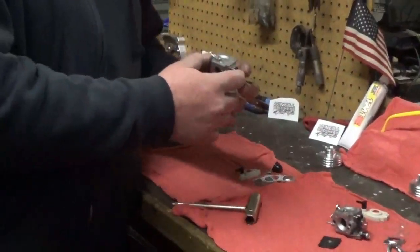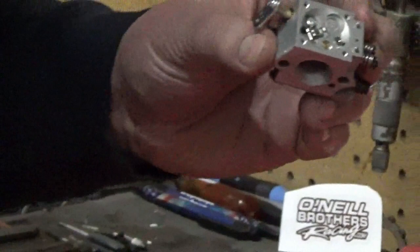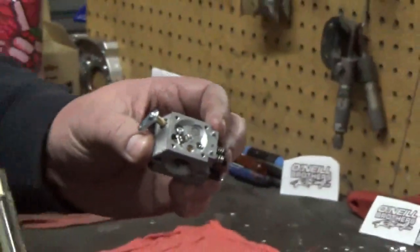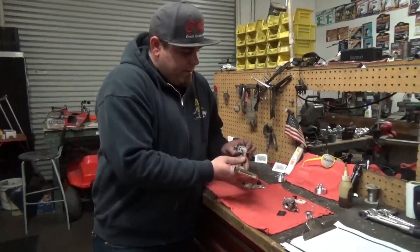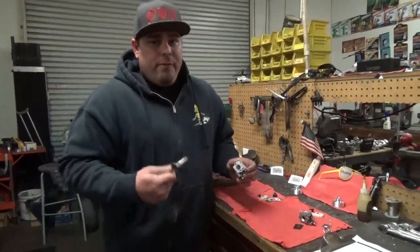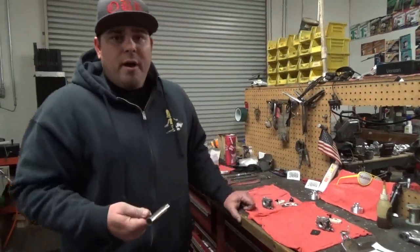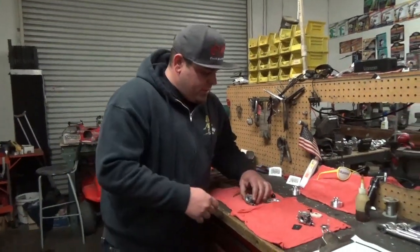Now here are the changes we wanted to make. If you look on the inside, you can tell the levering is different — that's partly because of the spiral diaphragm and partly because of the pop-off spring we're running. This carburetor produces more fuel at a lower RPM. We have a softer spring in here and also a different plunger, so it's allowing more fuel to come in at a sooner RPM. That is the key performance change between the two. In the video we'll show you the pop-off pressure that will tell you the difference.